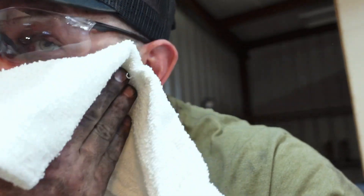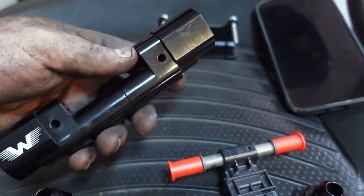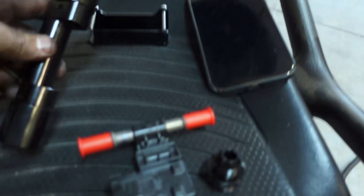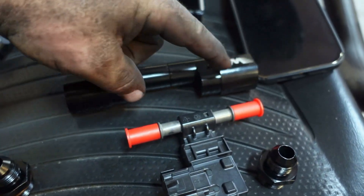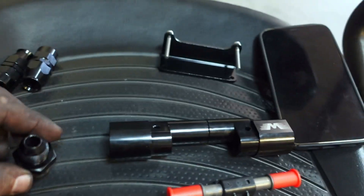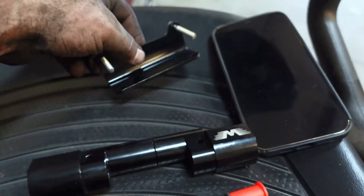I've officially mounted the feed line. Now I can move on to mounting the E85 sensor. This is the billet mount — it's a two-piece design and it has a Dash 10 so there isn't gonna be any flow restrictions. We're just gonna put the E85 sensor into here and then we have some ORB fittings that are gonna go on. I'm just gonna mount it on the front side of this vehicle, cut the line, and mount this — it can kind of go anywhere you want.